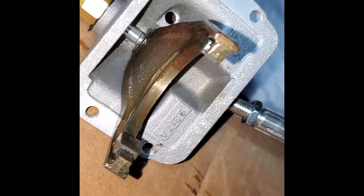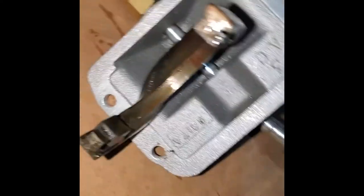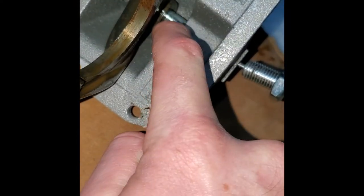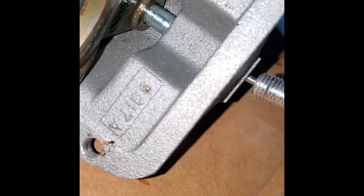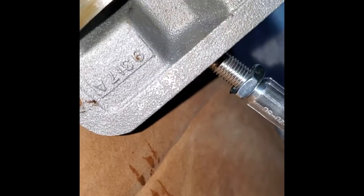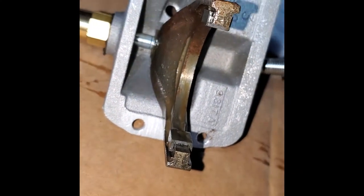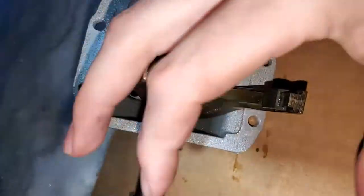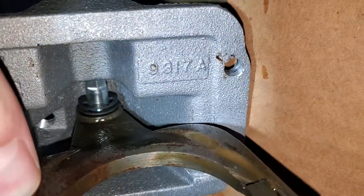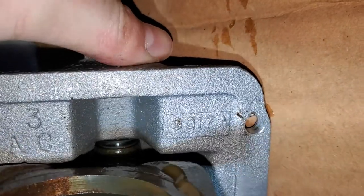You want it in the fully engaged position under the dash, which pulls the fork all the way to the cable side. When the cable handle is pulled all the way out, they want that second snap ring - not the one beside it but the next one over - to make contact with the edge of the casting when the cable is fully engaged. Snap rings are in: that one there to hold the fork, and the other one is the stopper against the casting on this side, so that the fork doesn't make contact with the casting.